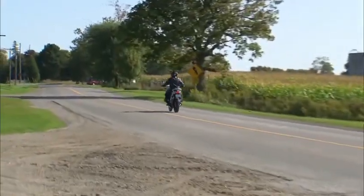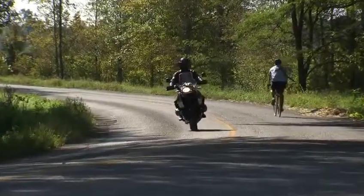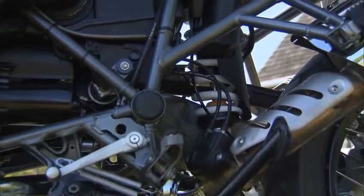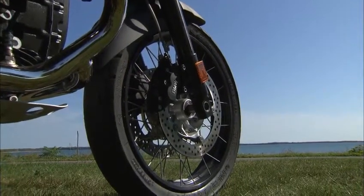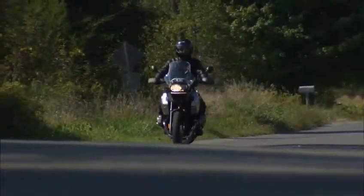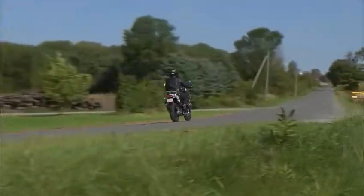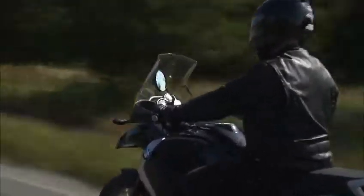How did you find the suspension and the handling of the bike itself through the corners? And we had some tight, rough roads today. Well, that's an interesting question, because it's got 3 different settings. You've got a comfy setting, a normal setting, and then the sports setting. And you can notice the difference. On the comfy setting, it's spongy, but the engineering is such that the handling's not affected, even though the ride is softer. And if you dial it up with a quick press of the thumb to the sport setting, you feel the suspension tighten up, firm up. It changes the character of the handling, not dramatically, but enough so that it's worth changing depending on the road conditions.